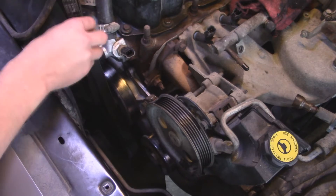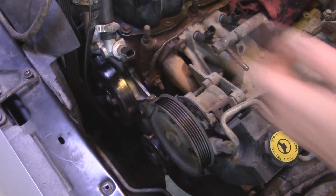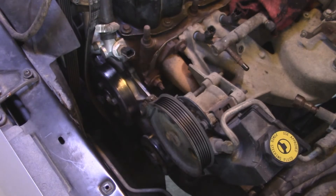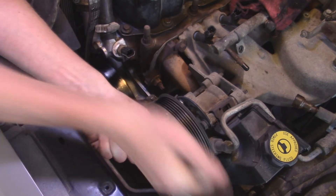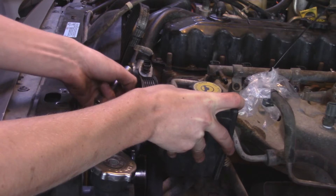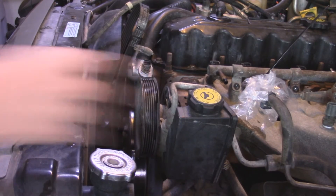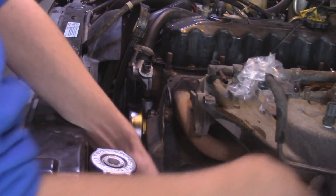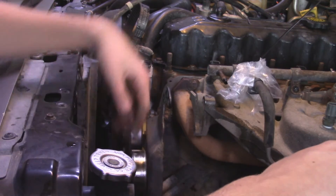Then you should be able to slide off the belt and move that out of the way for now. This pulley for the power steering pump actually has holes right in it, so that way you can stick a socket in and get these three bolts off for the power steering pump — these bolts are going to be a half inch. So once you have all your bolts out, just push the power steering pump to the side. You don't have to disconnect any lines — just tuck it away in the corner down here.